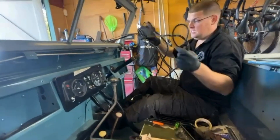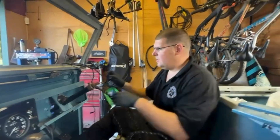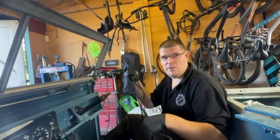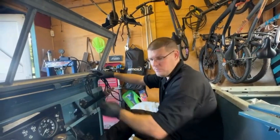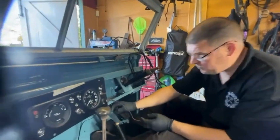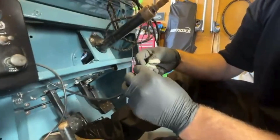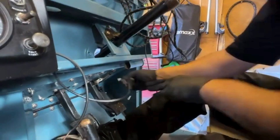This is the piece of loom that runs through the chassis to the back of the vehicle. We haven't run this through yet — I have taped it up ready to pull through, but access is not the best, so that is a job to come back to. Coming around to the dash, we've got wires coming through — I can't remember the colors, I'm just going to pop them off. We've got a green and a purple, and the green gives you the brake light switch.